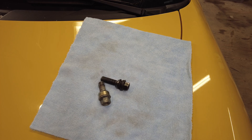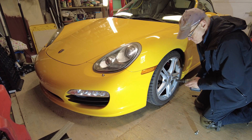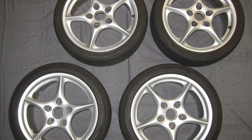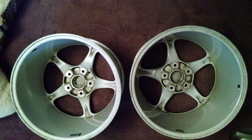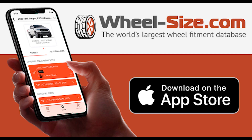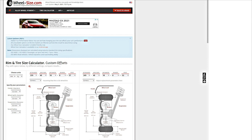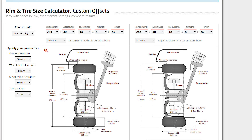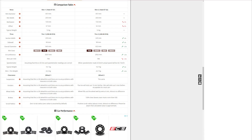Often the longer bolts are purchased as a set with the spacers. If you have your eye on a nice set of Carrera lights and aren't sure if they'll fit your car, head over to wheelsize.com, which has a handy calculator that visually compares various fitments from your input. For spacers, just subtract the spacer thickness from the offset value — for instance, if you have an ET 50 wheel with a 10 millimeter spacer, use ET 40 in the calculator.